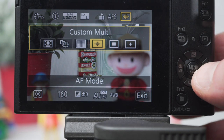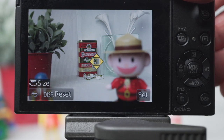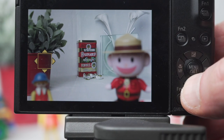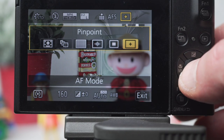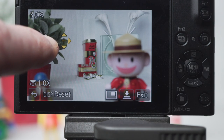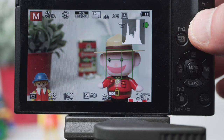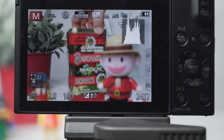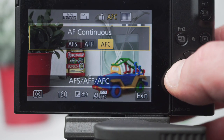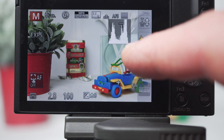Focus area options include 49-area, a custom configuration for a specific area, and one area which can be moved and sized in eight sizes. Small can be positioned anywhere on the screen using a 100 horizontal by 60 vertical grid, and even the extreme edges are usable. There's also a sizeable movable pinpoint with an expanded view focus assist. Face detection with eye detect, and tracking — press the shutter to activate, it works well with 4K photo mode and it's faster than most. Three autofocus modes: single, continuous, and hybrid. And touch focus, which combined with touch shutter is an elegant solution when autofocus doesn't quite get it.